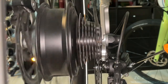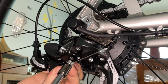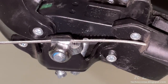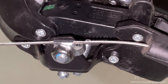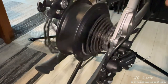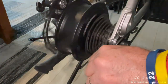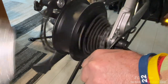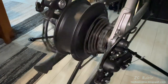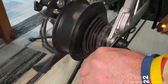I verify visually between the two sprockets that alignment is good. With the high limit set, the cable can now be reintroduced and tightened. The witness mark shows the cable is several millimeters off from the factory position. Clicking into sixth gear, it doesn't move as expected, so I turn the barrel adjuster anti-clockwise a number of turns until it eventually makes its way into sixth. I give it a little more turn and verify both sprockets are lined up visually.